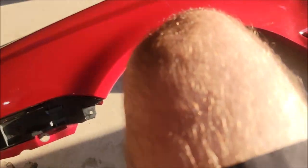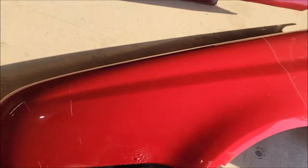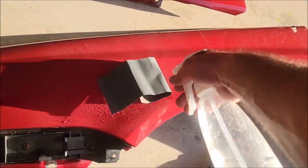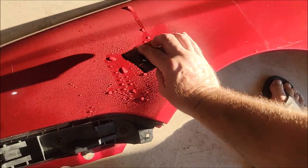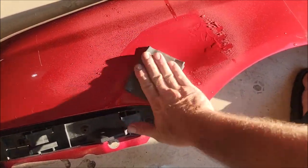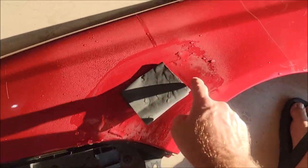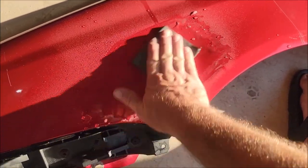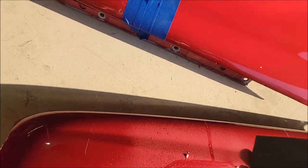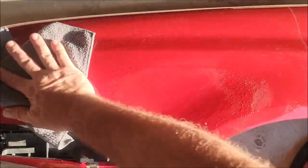I've wiped the panel down. I'm going to sand just this section here. I'm going to wet this out and wet the paper a little bit. I would do a lot more prep if I was actually sanding a full car. I fold the paper into thirds and put it down. You can see right here that I'm taking off material — it's very obvious in the liquid. So I've sanded with the 2500 grit. Now we're going to wipe the panel down and then polish that section.